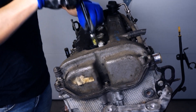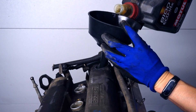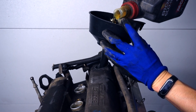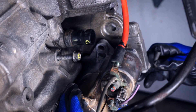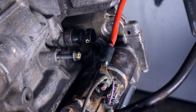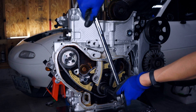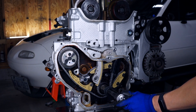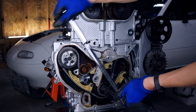With the motor sitting pretty, remove the coils and spark plugs and fill some oil into the crank case. I had a few jugs of various leftovers that were enough to fill it. I also got the working starter motor bolted in place on the block. Now I'm going to assume that you can rotate the crank freely on your motor, because if you can't, you've got yourself a bigger problem that you should probably address before doing a compression test.